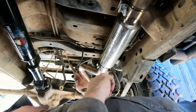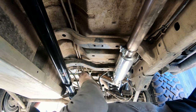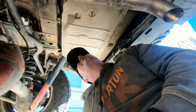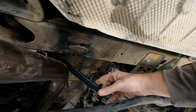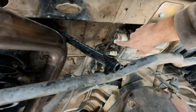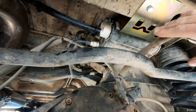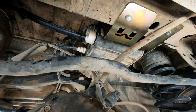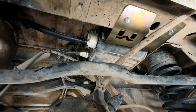To reroute the power cable and hoses, cut some of the zip ties holding them in place, then reroute everything to reach the new location. The kit does come with a few extra lengths of hose and you may have to use them — there's a short piece and a longer piece for the big hose, which wasn't quite reaching, so I had to extend it. As you can see, the EVAP canister is now completely up and out of the way. If you can hit this thing you are seriously doing some crazy off-roading — the axle will protect it, so no longer have to worry about the EVAP canister.